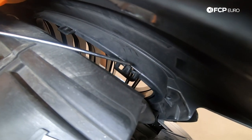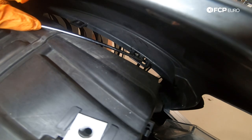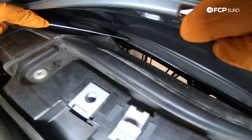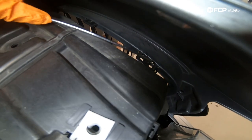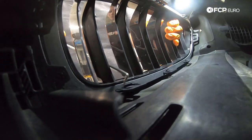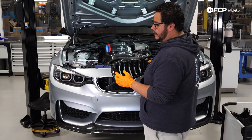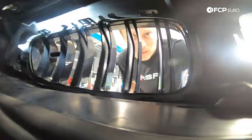With the hardware removed, pull down the front top half of the bumper just enough to squeeze a pick tool in and work on releasing the top tabs for the grill. Once those are started, get eye-level with the grill and work the lower tabs from the front. Starting from the far end, press down and wiggle it toward the outside of the car — working all tabs a bit. Then reaching through the front with the pick, raise up the middle tab to work the grill out. With all clips removed — arguably the hardest is the inside one — you can pop them out, reach inside with your hand, and work the other side out. Then remove the other grill.